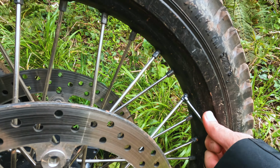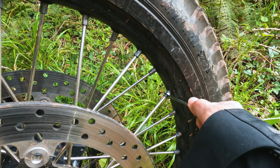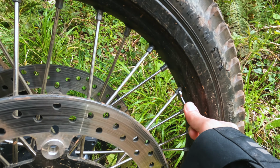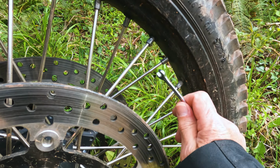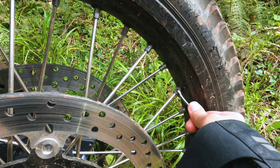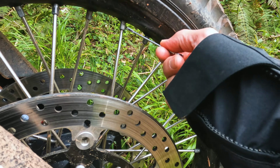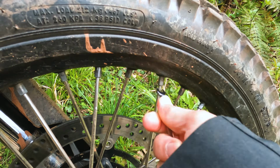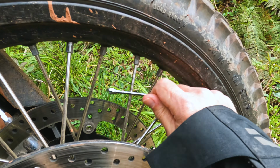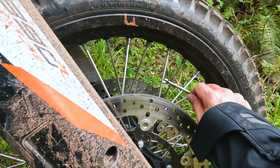What we do, when you're actually tightening them, it goes anti-clockwise, and you just keep hitting the spokes and keep tightening. I sort of just took the average of the spokes, so found out what most of them were doing, and then found any duff ones. That's nearly there. Almost. It's very, very small amounts of movement. And that's pretty good actually. Then if you go around, that's a bit loose as well. Give that a bit of a tighten. There we go. And it should all sound really beautiful, like playing a harp, a metal harp.